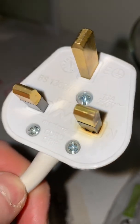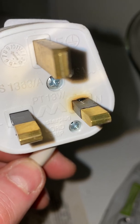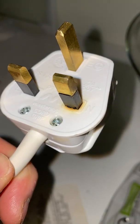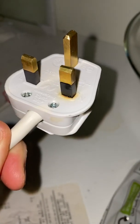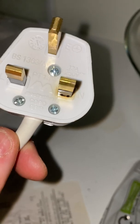That will only get worse, so it's worth getting the oven hardwired in. Otherwise, if we just change the plug, the same thing will happen over time and that will be quite a nasty fire risk. So we've stuck a fault label on it, notified the duty holder, and taken it out of service so there's no further risk until it can be repaired.